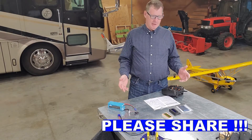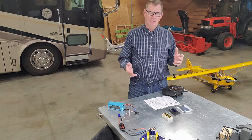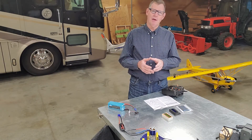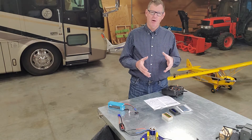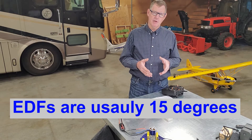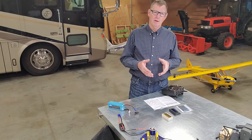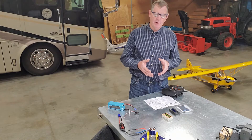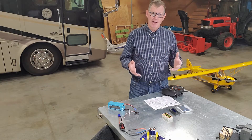So why would you change timing in the first place? Well, these motors are all a little bit different. They've got small ones that have only maybe four poles or two poles, all the way up to very large motors that might have 30 poles. Anything over six poles, you're going to want to raise that timing value up to 15, 20, 30 degrees. Most of the 60cc and higher, I've got it at 30 degrees.